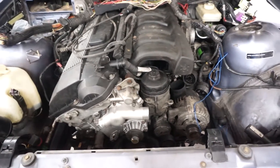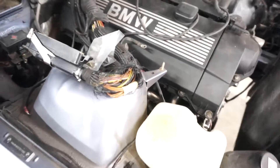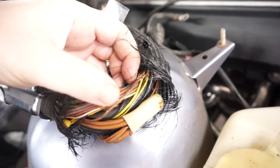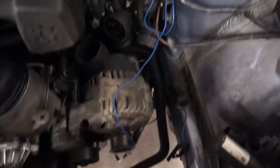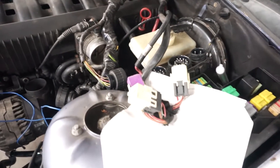The cap bolts are also torqued down. The goal for today is to get this engine to fire up, and the first thing of course is to get oil in it, so I'll be doing that momentarily. I'm going to be running Liqui Moly 5W-40. I was also going through this wiring harness — it's not in great shape. This ground wire is like melted, and there's other damage in here. I was trying to trace back this blue wire that we didn't know what it went to, and if I'm correct, although continuity isn't there, it comes to red and white which I believe is switched power.